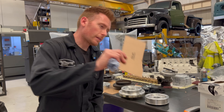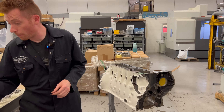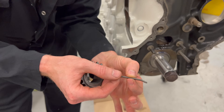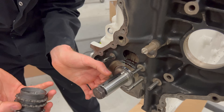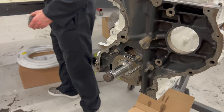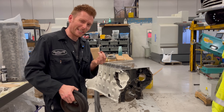Let's go around this side and look at the original crankshaft. Using the powers of having a workshop and real items at my fingertips, I can show you how the original crankshaft pulleys were fastened. This — which I just had to pull out of the bin — is the original crankshaft keyway. It's like a little band of steel, and it basically sits in those two Woodruff slots. Then this pulley that drives the oil pump and cams sits over it, gets pushed to the back, and the crank pulley goes on the front, sandwiching those two items together.